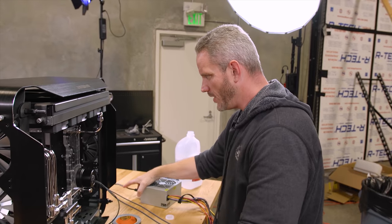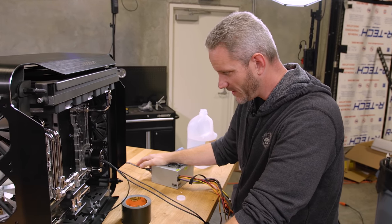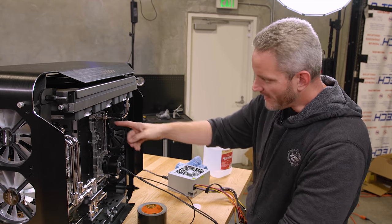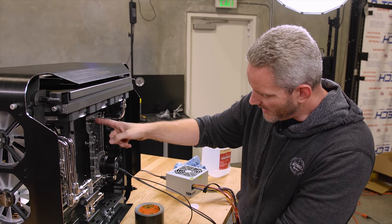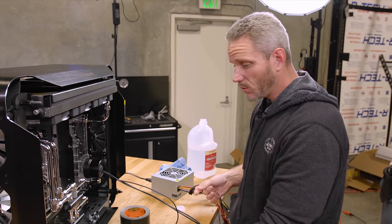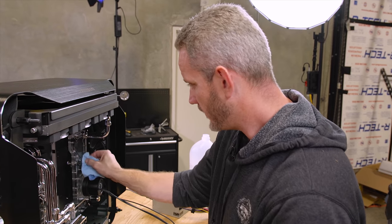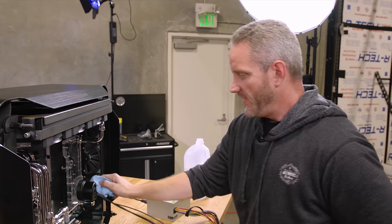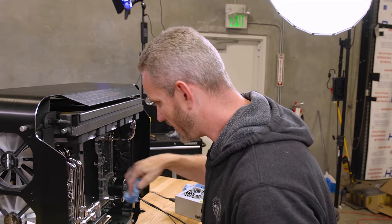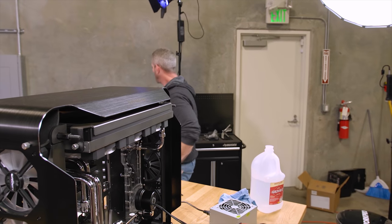This is a PWM pump. So what I'd like to do right now is slow it down and have it not run so fast. Because when it's running so fast, it sucks a lot of the bubbles back in before they can get up to here and let the air settle at the top. Another reason why I really do like tube reservoirs better than distro block stuff like this. This has a lot more work involved to get it all truly bled, but it looks super clean when it's all done. So what we're gonna do now is go ahead and wrap up this video